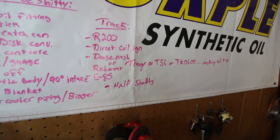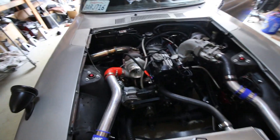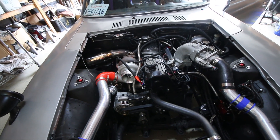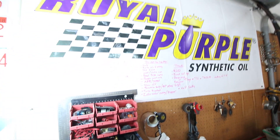E85 is super easy to do. The other issue is the rear end - currently with this setup, if it breaks the wheel literally falls off, which is very dangerous. We need an R200 - the R180 will definitely explode - and the R200 also has limited slip. All this drivetrain stuff is going to cost like five thousand dollars easily, just to make sure it doesn't explode when we actually go to the strip. We might be able to pull a ten-second pass with the T5 since four-cylinders don't make huge torque figures - we'll try it first until it blows up, then invest the money.